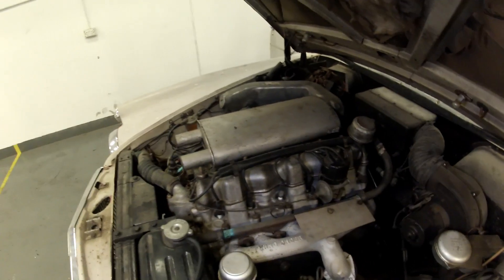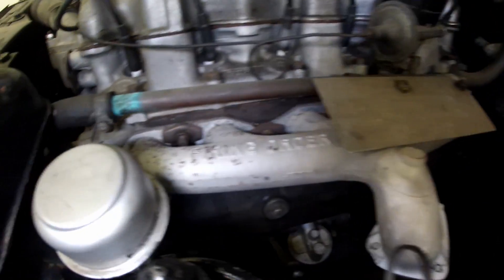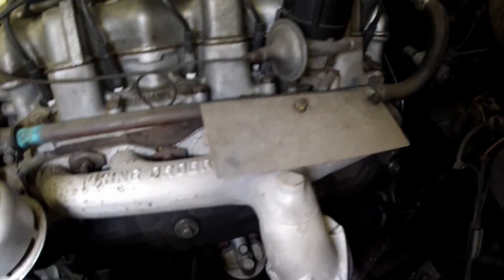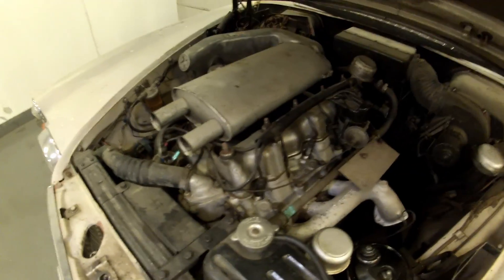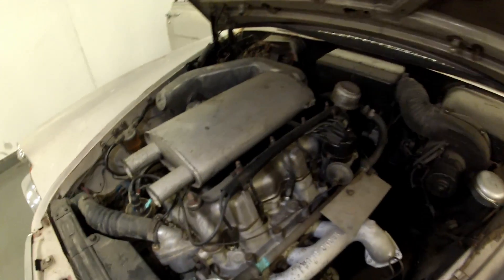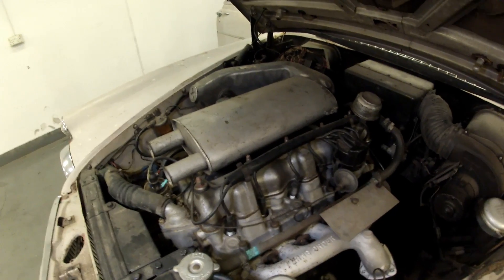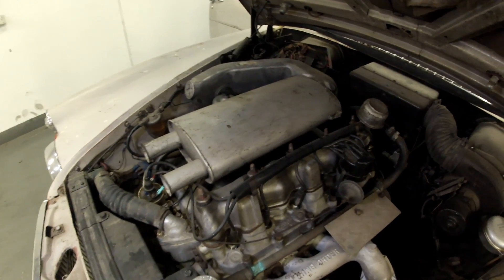You can see down on the side here — if I hold the light — where you can open up this cover and actually get to where the side valves are underneath that exhaust manifold, and then obviously the intake valves are at the top. This engine has a reputation for being a very smooth and refined engine, and even in this particular car which is in great condition, it certainly is. Being a long stroke engine, it doesn't rev very hard but it has a lot of torque from rest and it's incredibly smooth.